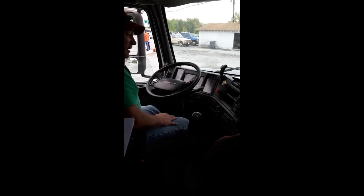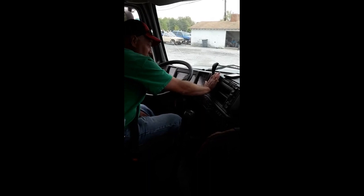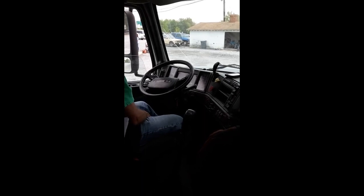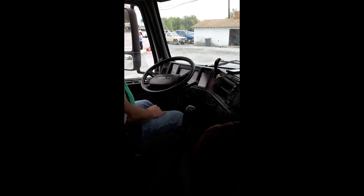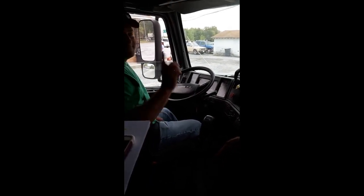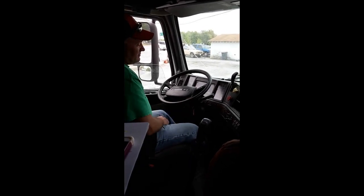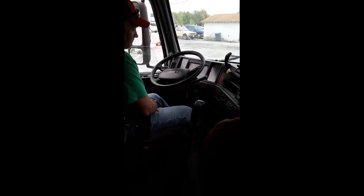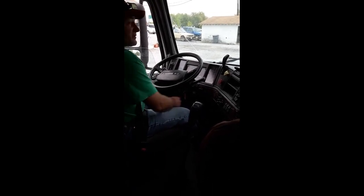Feel that? Now I want to check my service brake, or my foot brake. Both buttons are in. Ease forward slightly. Foot brake works. Do I pull them out? No. Why not? Because you have to do your lab. There you go. I'm just building my pressure back up. Notice still in gear, still have my clutch pushed in. That's close enough.